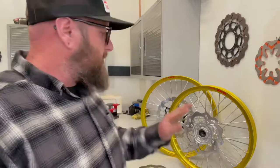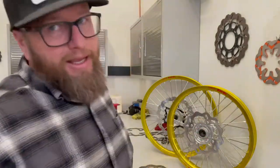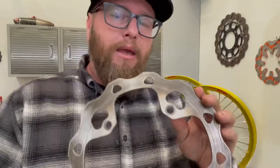When it comes down to replacing brake pads - say we're just going to replace the pads, you've spec'd out your rotors, they're fine, you've sanded them down and they look fantastic. Then let's just get rid of the brake pads. One of the things to remember about squeaking brake pads is that whatever is on the surface of these pads is going to embed itself into the rotor, and that's where another problem lies. When these pads press down under that level of heat - really really hot - it embeds the material into the rotor. Sanding isn't always going to pull out all of that bad material or oil.